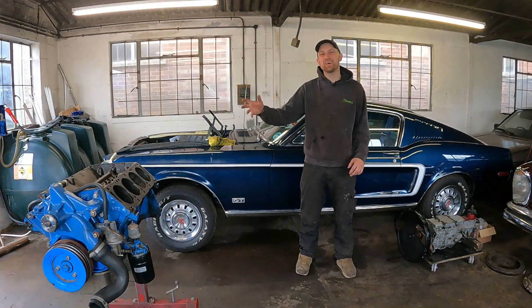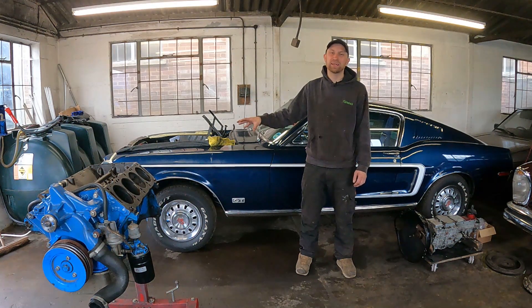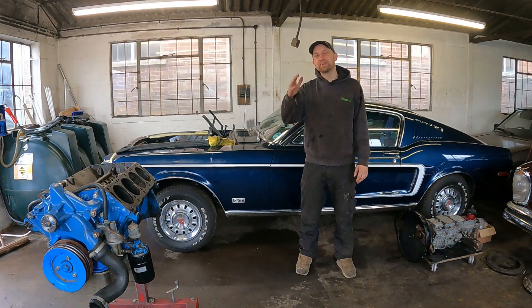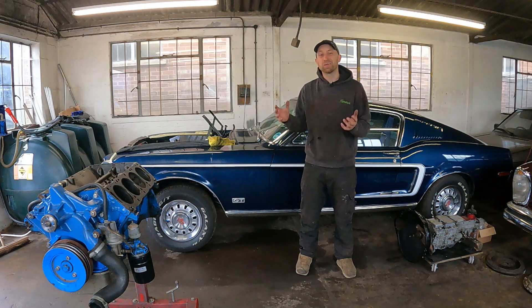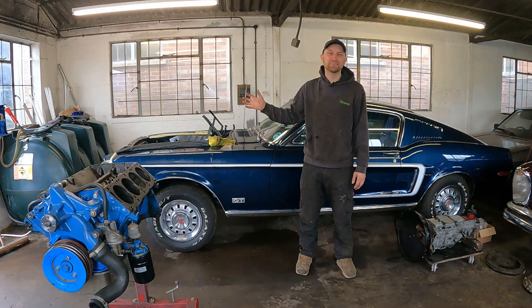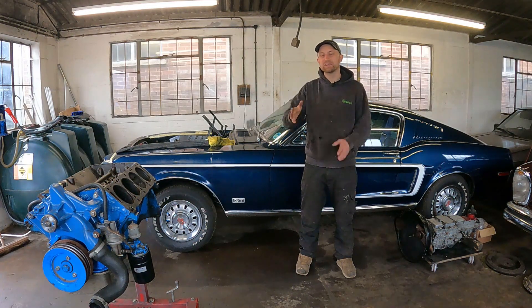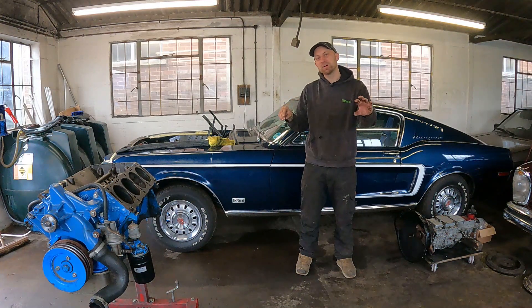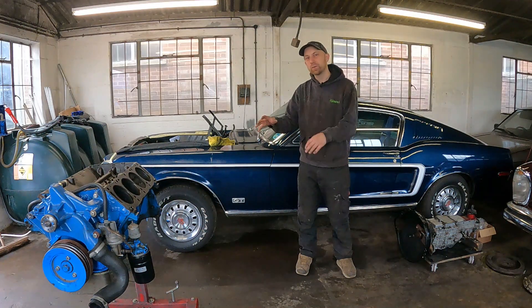We diagnosed it when it's in the car that it had a hydraulic lifter failed, but the problem with this car in particular — it's had a rack and pinion steering setup and coilover front suspension added, and they've welded in a cross member which is not removable, which means it hugs the engine. You can't move the engine about and you can't get the sump off. So I had quite the adventure getting this out in the last episode, but we've got it out and now we need to look at getting the cam out, because that hydraulic follower that broke actually must have rimmed over so we couldn't lift it out the top. So we're gonna have to take the camshaft out and drop the follower down into the sump, which now the engine is out, we can get the sump off.